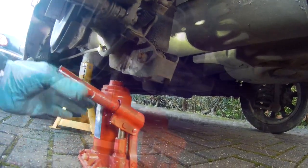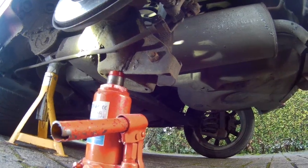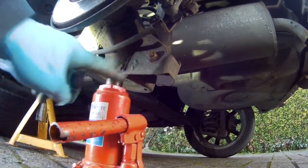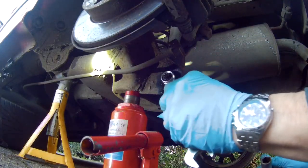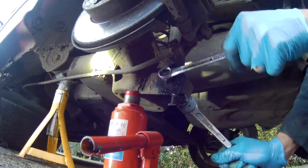Now it doesn't matter whether you take these bolts out at the top first or you take the bolt out at the bottom, but what you must do is put a small jack underneath the trailing arm and just jack it up slightly, just to take off the pressure. When you release the bolts, the trailing arm would drop down and possibly risk knocking the car off the jack. You will also need the jack to install the new strut. Now undo the bottom bolt, which in this case is a 17mm wrench and a ring spanner on the nut. Make sure you put some penetrating fluid on this, as these very often corrode quite badly.